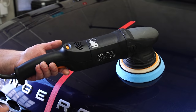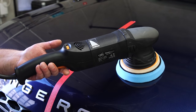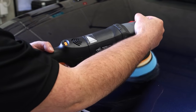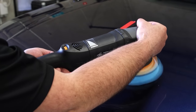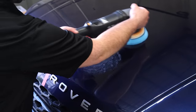I'm right-handed, so I'll place my right hand over the front rubber grip, which will act as my controlling hand. My left hand will hold the base end of the polisher and act as my guiding hand. I'll then turn the Shinemate polisher down to its lowest setting of one, turn it on by flicking the power switch, and quickly spread the polish over a two-by-two-foot section.